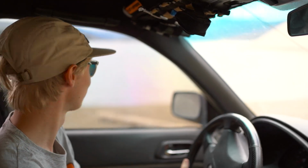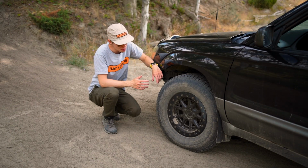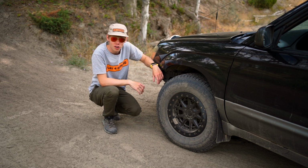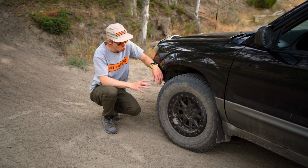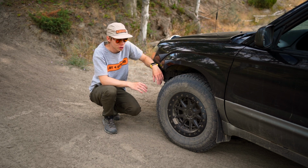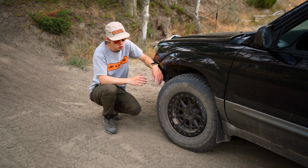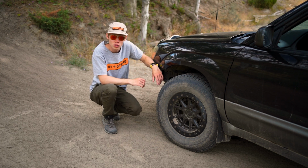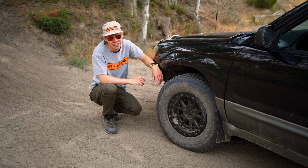And if you have the means to air your tires back up, I would recommend decreasing the pressure when you're driving on sand. This will ultimately give you a little more of a contact patch in the sand and a little more flotation. For aftermarket all-terrain tires, you can go to around 15 PSI, and for the stock Subaru tires, I wouldn't recommend going much more below 25 in case you do de-bead a tire, which is going to be a pain in the sand.